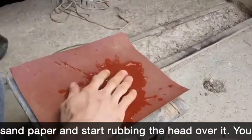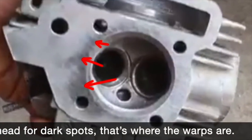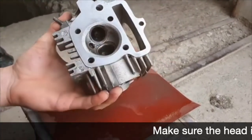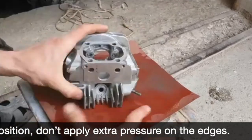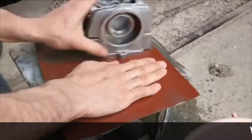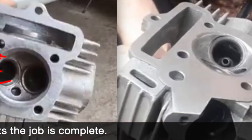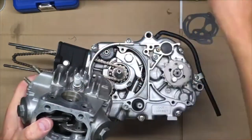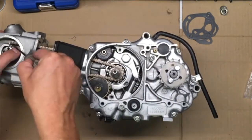In 1976, the K model designation was dropped. Due to U.S. federal regulations, manufacturers were required to declare model year designations. The 1977 model saw a return to body color upper fork covers and headlight mounts. Shiny orange was the only color offered. The 1978 model was the only CT70 ever painted black and this was the last year for the engine spark plug guards, chrome-plated muffler heat shield, and folding handlebars. 1979 saw the introduction of BMX style handlebars and was the last year for the second type hydraulic forks, upper fork covers, and seat trim strip. Muffler heat shields were painted black and the rear shock covers were gone from 1979 on, as the last of the chrome disappeared due to cost.